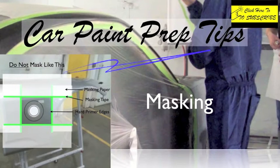Now if you did mask a square edge like this, you would not want to prime all the way to that tape edge, because that would leave a hard edge, and those hard edges are hard to sand off. It takes a lot of extra time, a lot of extra effort, and I've even seen where you sand those edges off, and after it's painted you still see that edge a little bit.